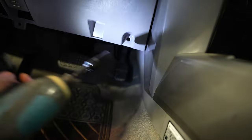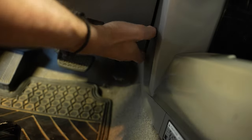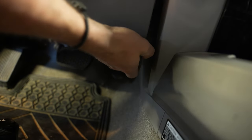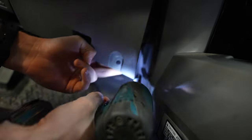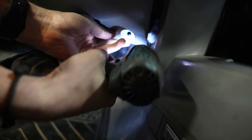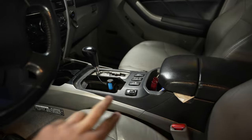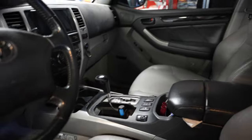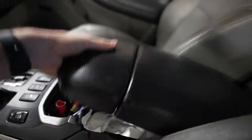Now we are removing everything. Inside the truck, you've got a 10mm bolt right here — undo that, then pull this loose nice and gentle. There's a little one behind that as well — also a 10mm. Once that's off, we're going to have to take off a bit of the center console. Don't get too overwhelmed, we're gonna put it back together the exact same way. Next step we're just going to pop this piece up, take it off from here.